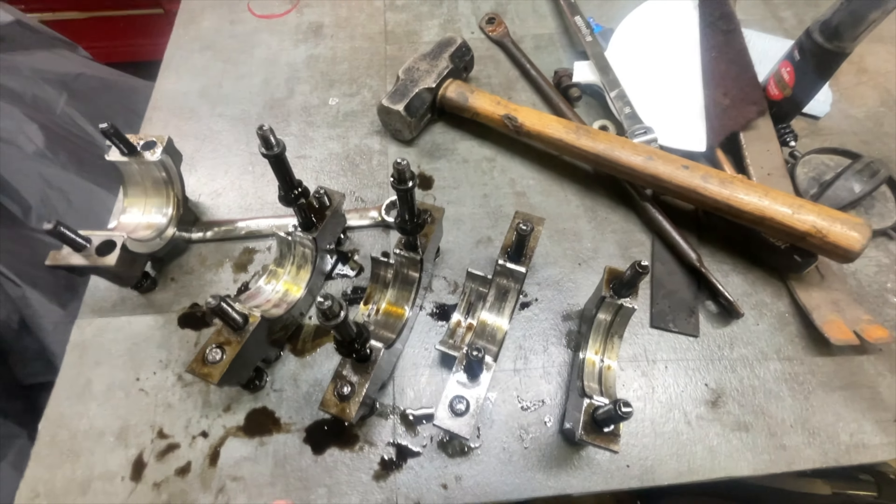This is the final carnage of what we were dealing with. I took all the bearings out - the thrust main one isn't bad, the front one wasn't too bad, but the middle ones, as you can see, were pretty much wasted. Really bad. All these pieces of metal were up inside the strainer, which prevented all of this from getting inside and doing more damage to the motor, thankfully. So I pulled all that out, cleaned the strainer out really good, flushed it all out, opened up the oil pump and did a good inspection. I checked the clearances and everything's nice and tight within spec - we've done no damage to the oil pump. Cheap enough to replace if I needed to, and I would have replaced it if I was in doubt. I still even had good oil pressure when I shut the truck off - it just had a slight knock to it. I wanted to take it apart before it got any worse, so I think we're going to be all right with this.